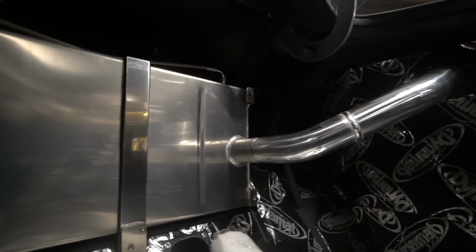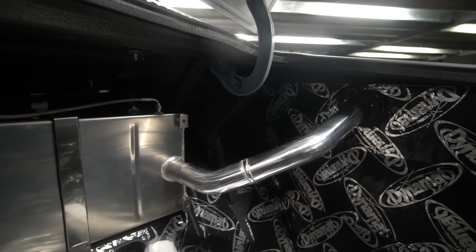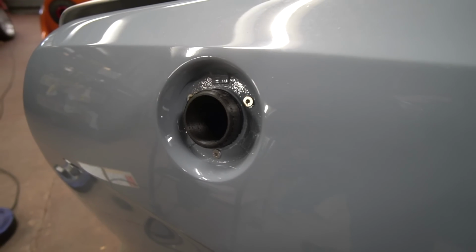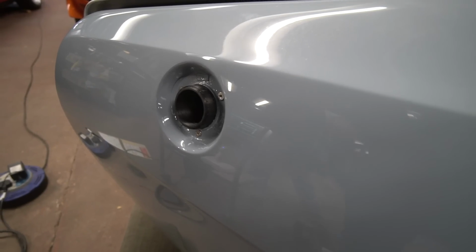So they've done the model of the actual neck, done a 3D print prototype so we can just check the fit of that, and Jim's welded up the pipes. Now what we've got to do is just get that model sent away to be machined, and then when that gets here, weld it all up, and we'll be good to go. And there'll be a spigot on that for the vent pipe up here as well.